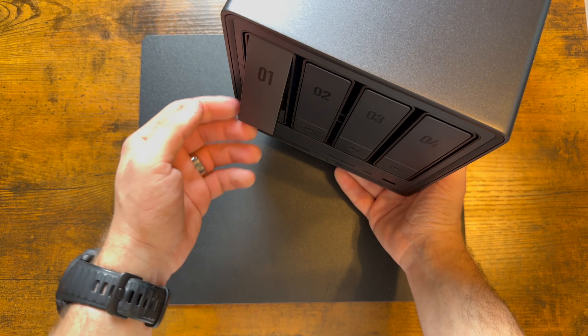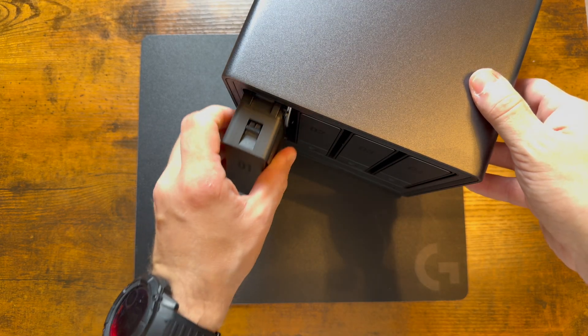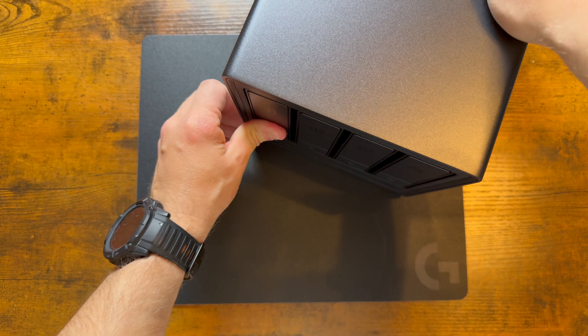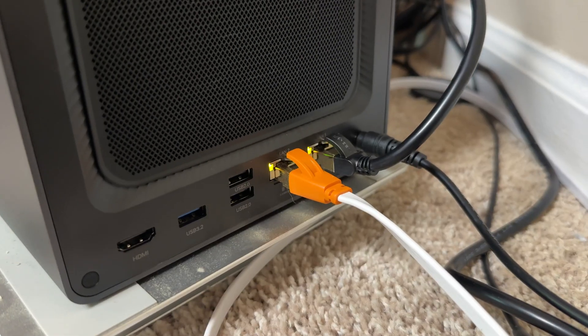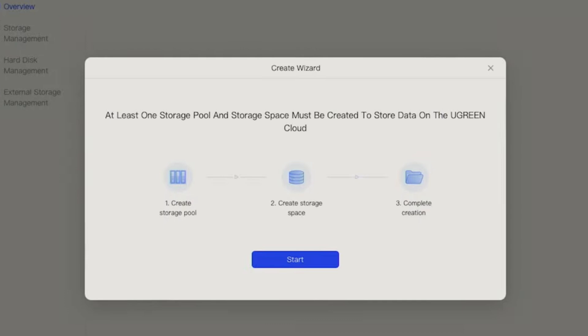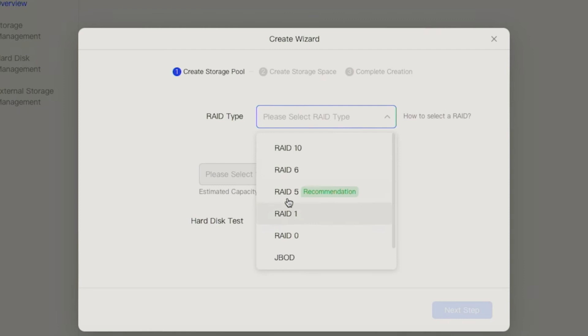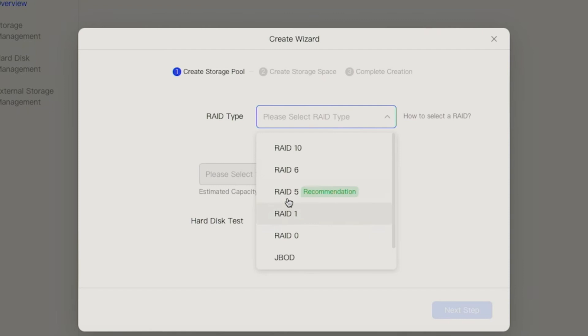Installing the drives is as easy as pulling out the tray, pushing the lock to extend it, putting the hard drive in, locking it into place, and simply sliding the drive back in and pressing down on the lock. The setup process is also super simple. Once you connect your NAS to your router via ethernet, you go to find.ugnas.com and it will automatically find the NAS on your network. You create your username and password. It'll ask you to create a storage pool — do you want all four drives as one huge storage, or three drives as one storage and the fourth as separate? Then it'll ask which RAID you want to use — I'm using RAID 5. Afterwards, it'll ask how much storage you want to use for that pool. That's it. You've now set up your NAS and it's ready to use anytime, anywhere.